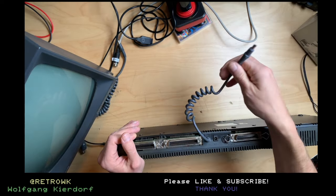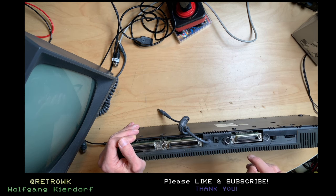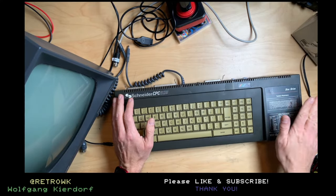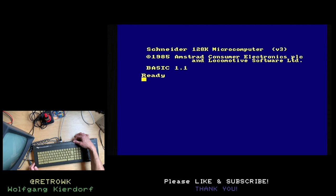Port-wise on the 6128, we have a tape port, joystick port, audio out, printer port, an expansion port, five volts, and 12 volts in for the disk drive. You have to plug this into the monitor, which only works with a GT65 or the color version. You have a disk drive connector for the ribbon cable, the built-in interface, power switch, and volume knob. On the other side, you have nothing. I did change the belt in this a while ago — let's check if it still works. And there it is — that's BASIC 1.1. I think the 464 had BASIC 1.0.